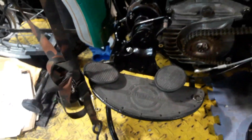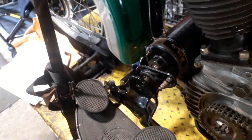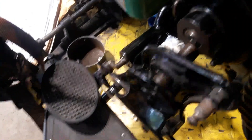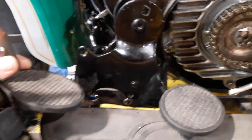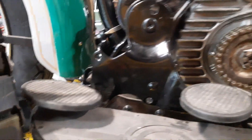I thought I was going to get a lot of work done on the Harley and get the clutch totally done. The new clutch cable came and it actually bolts up perfectly to the mounts on the frame - it's an aftermarket one but it's a really nice piece. But when I went to put the pedal assembly on, it's running into the generator. I took the cover off the generator thinking maybe something was a little odd, but nothing seemed to work - it kept running into the generator. The foot clutch only has about an inch of travel, and there's only one way to bolt this frame on - a bolt there and a bolt there - so I was scratching my head for a few days.